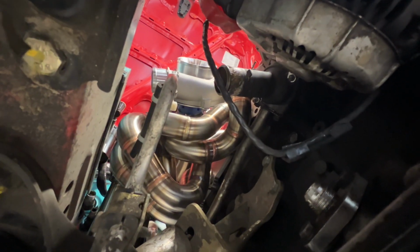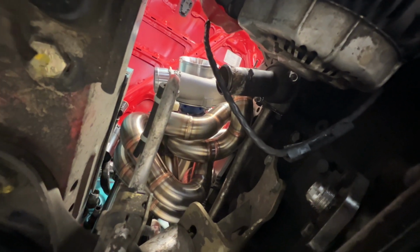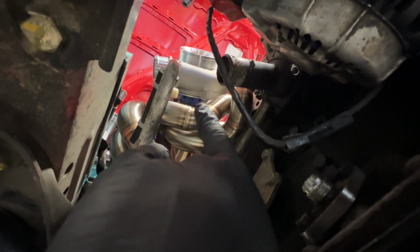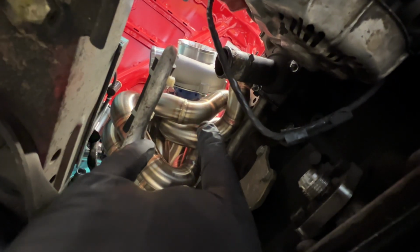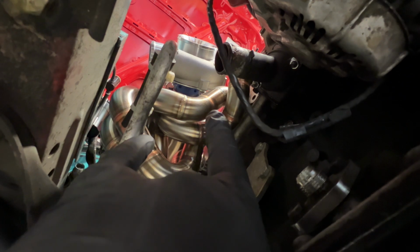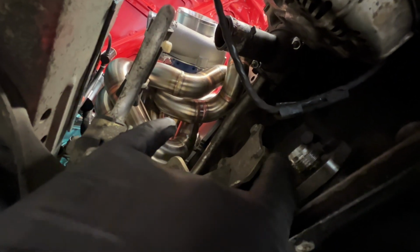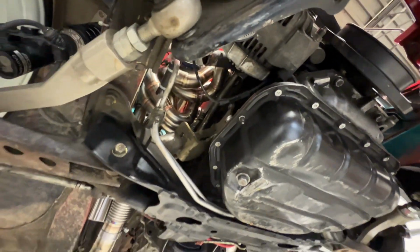So next thing I'm gonna do, I'm gonna make a hard line coming from the turbo drain, and have it snake through the manifold and weld a stainless AN fitting there, and then just a regular line to the regular drain, just to keep the AN line out of the high temperature that the manifold will see.